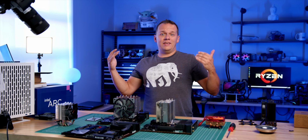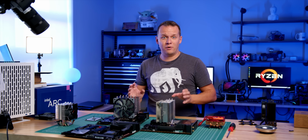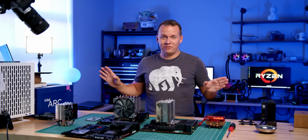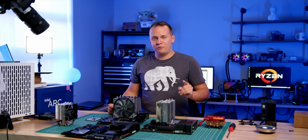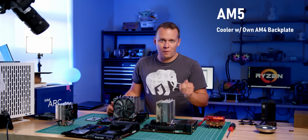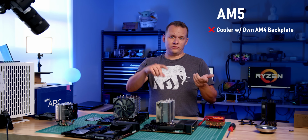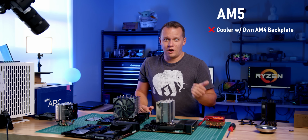So I guess this brings me to the end of this video. I know I've got so many things scattered across the desk right here in front of me, but I needed to get this on camera as soon as possible to head off any misinformation at the pass. So the big takeaway from this video is if your cooler replaces the AM4 backplate, then it is not compatible. It doesn't matter if it's an AIO, it doesn't matter if it's an air cooler, it doesn't matter if it's a potato, it will not be compatible.